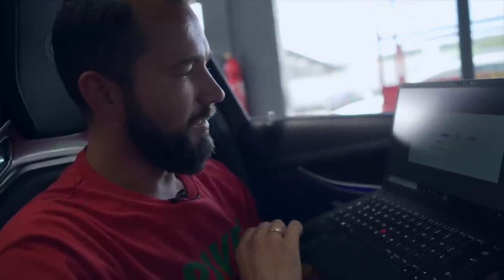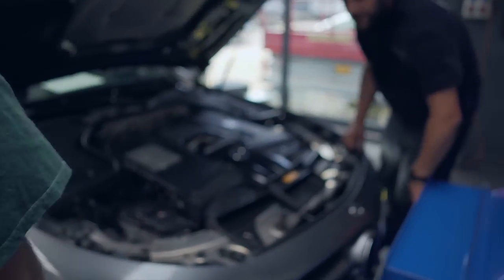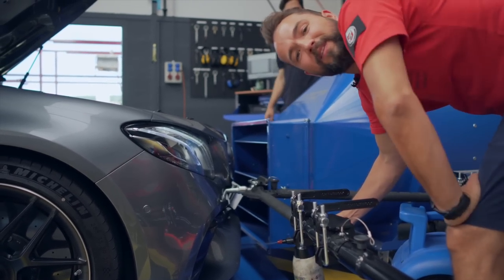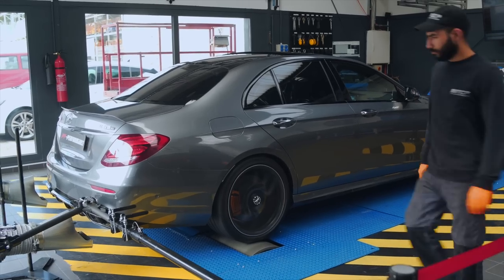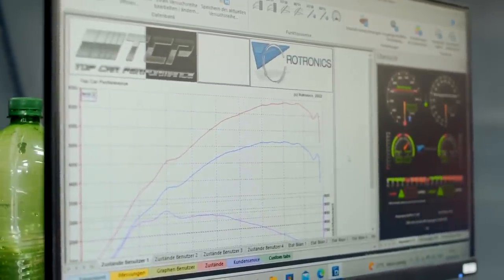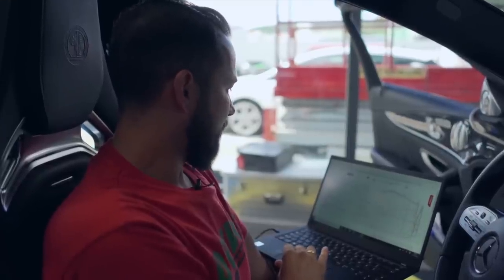The software is already finished — we will show you the parameters I changed later. I need to prepare so this doesn't run too long. We'll now go to the AutoTuner and load the finished file. Then we'll do a measurement. It is hot today, almost 30 degrees. Let's do it! The performance result is ready: we have 642 PS and 918 Nm in stock, and a maximum boost pressure of 1.5 bar.